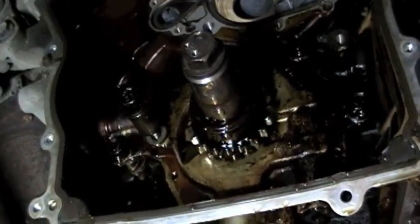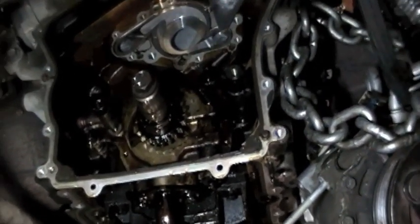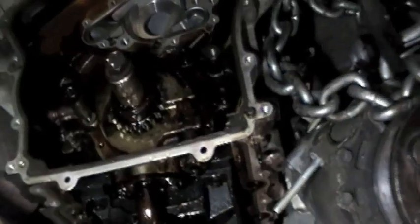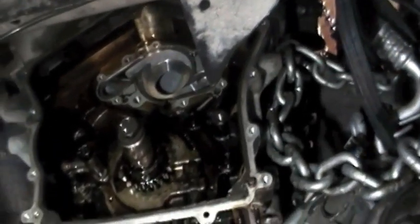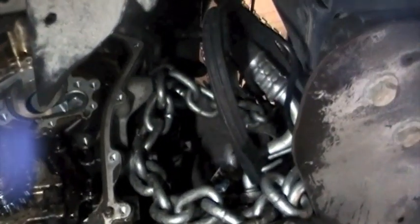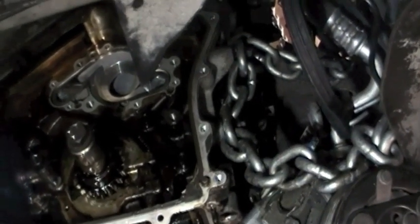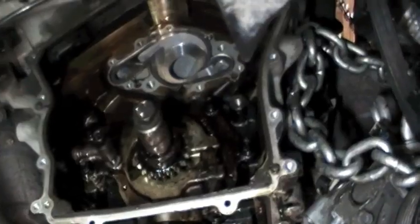This car was diagnosed as a cracked engine block near the thermostat housing. The person I bought this car off of believed it needed a new motor because the block was cracked. I bought this car with the intention of replacing the motor, because I know these engines are so problematic, and I was going to swap it up to a bigger engine - maybe a 3.2 or a 3.5. But I thought I'd check out this motor first. When I did, there was coolant leaking out, I tore off a few things - the alternator and AC compressor - and found out it was only leaking out of the weep hole, which means it was just a water pump shaft seal that had gone bad, and that's why this motor just began starting to get oil sludge.